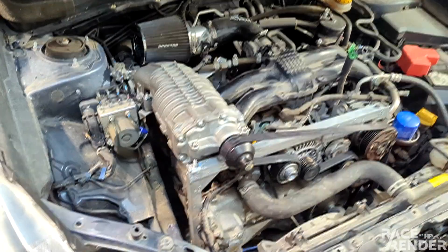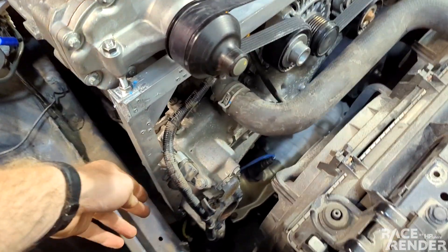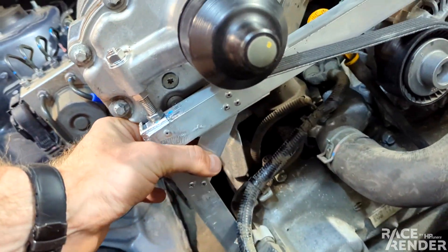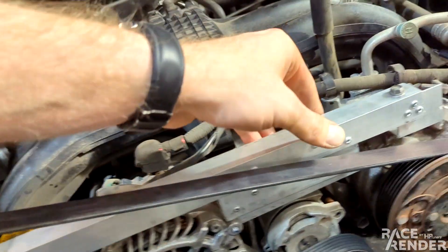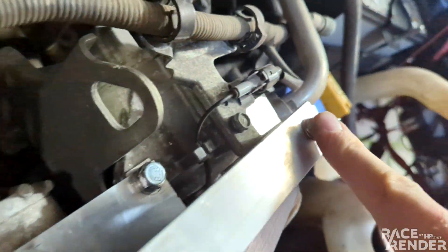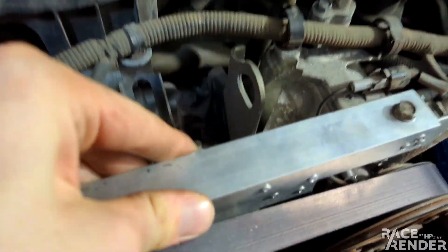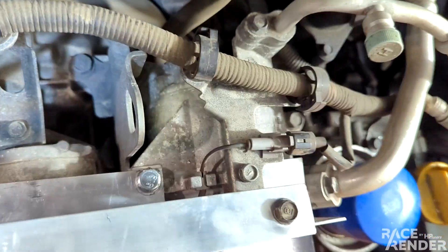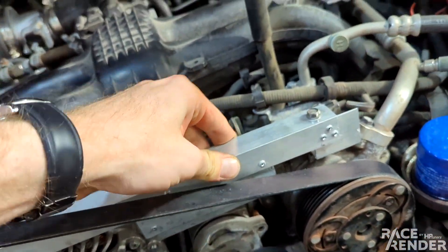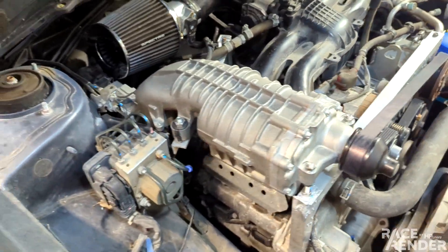A quick rundown of the progress so far: I spent all day reinforcing this bracket, which goes from down by the timing cover up here. I've got a little triangular section here — this was the hardest part to reinforce. I was only relying on this little bracket and it started to actually crack right there. So I've found two more things to bolt to: the AC compressor and also the alternator right here. I'm just using aluminum plate everywhere I can — this is all leftover from past projects.